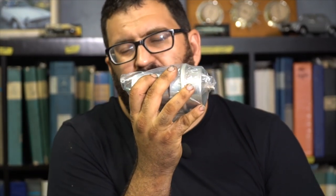A similar thing can happen with the small accumulators, although it is much less common. It does happen and will give you similar symptoms. With these, it seems to affect cold starting more. In fact, if your accumulator goes bad, your cold start will usually be okay, just because everything's cool and you have a gush of fuel coming into the system. With the small accumulators, you may get some starting issues during cold start.